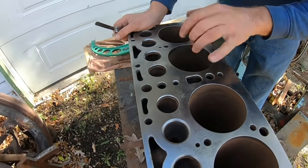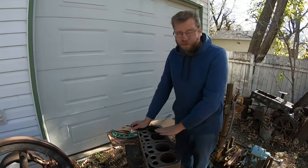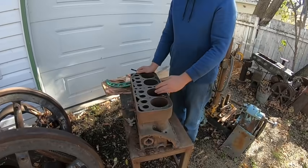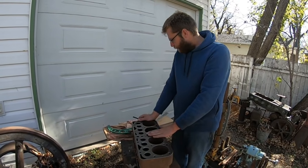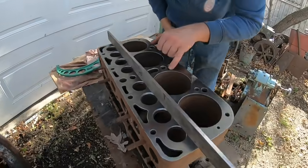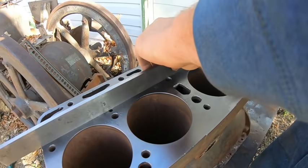Like I said, I have so many blocks. The time it takes and honestly the money — we do it on the big rare stuff. If that engine was cracked we would do it, but on a Model A block these things literally are a dime a dozen. They're getting harder to get but there's still lots of them around — probably not worth it. I did some quick measurements on here. The deck is actually in really nice shape; it looks like it's been surface ground — you can see the serrations there.